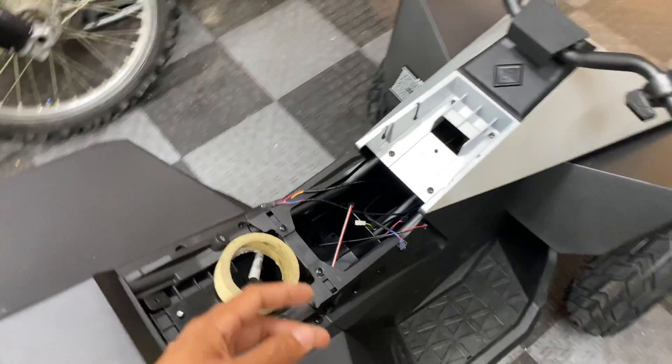Welcome back to PAD Outdoors. Today we're going to be hopping back on the Tesla Cyber Quad project. In the previous part one video, I went over all the parts I'm using, how to wire up the Kunray controller to make the motor spin the other way or reverse the polarity, and I also went over the differences between the stock 500 watt brushed motor compared to the new thousand watt MY1020 motor that we're installing today. We're actually going to install the motor on the rear swing arm — I just need to modify the mount bracket along with the rest of the Kunray kit.